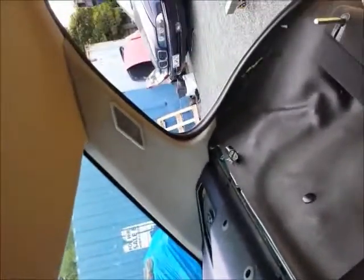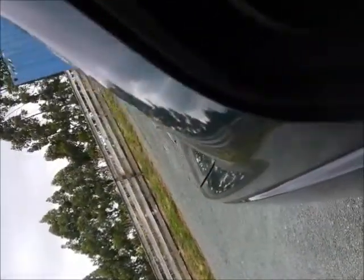One more thing I forgot to mention — the C-pillar panels also need to be removed. Make sure your hands are clean or else you'll get dirt on here. These are already kind of dirty so I'm not too worried about this car. You get your hand under there and just gently pull it out — sorry if the camera's not quite getting this, it's kind of awkward — and once all the clips are out it'll just lift up and out. I'm not going to disconnect the lights. I'm going to do the same thing on the other side and then the parcel tray should lift out.